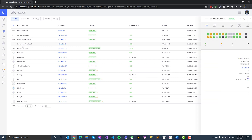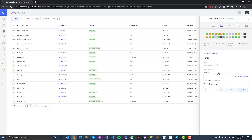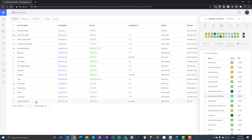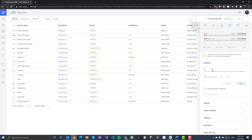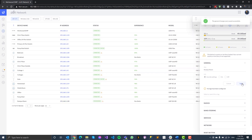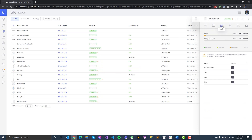It connected wirelessly to one of the other access points in the house. So I go to my primary 24-port switch, find the port that needs to be enabled, edit that port, and change the profile from disabled to all — the default profile for enabling that port. I had to change the mesh settings a little bit, but then it connected just fine through the switch. Now I just have another access point. In the configuration for the in-wall HD access point, I can change the name — this is the Rumpus Room access point. I can go to the ports tab, which looks like any other switch in the UniFi ecosystem, change the ports, and the first port also has PoE pass-through — 24 volt passive. I can name the ports and do whatever I'd normally do with a switch.